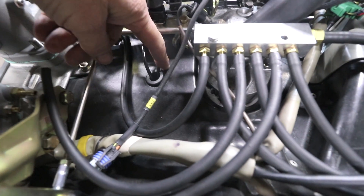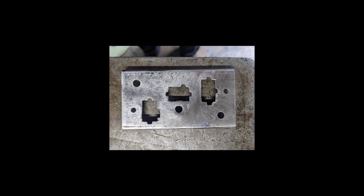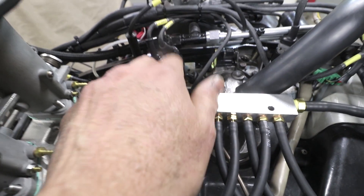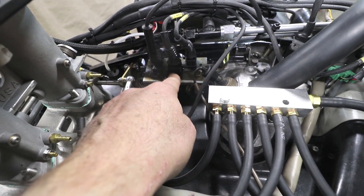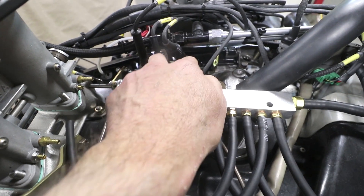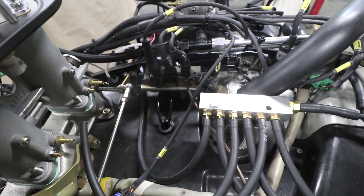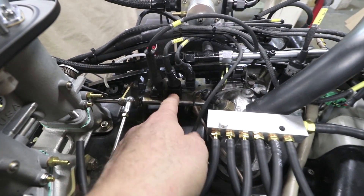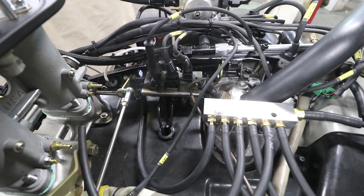The knock sensors come through this little hole in the fan shroud — I put a rubber grommet in there and made a bracket that basically holds the connectors. This one here is the 456 and this one here is the 123 — they're kind of switched, but based on wire length this one's just barely long enough, so I needed that to be the closest connector. That's the two knock sensors; this one happens to be the cylinder head temperature and I just wanted them to be clean on the same bracket. I'm going to disconnect them now and hook up an oscilloscope to see if we get a reading on these sensors and how much signal can transmit from one side to the other.